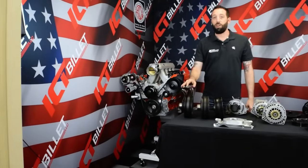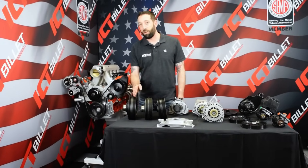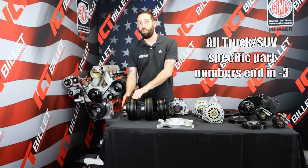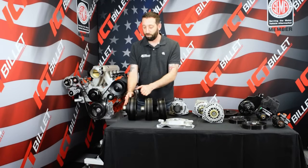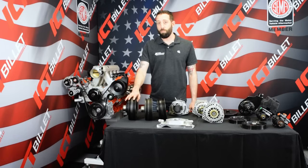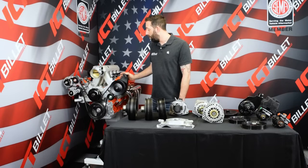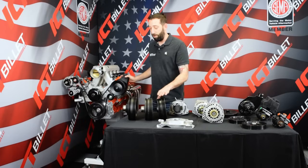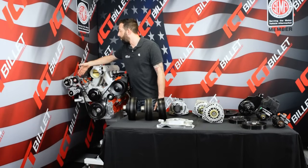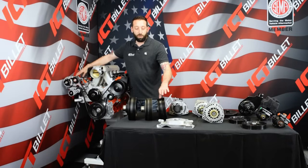The next thing you'll need to know is the belt offset. This one here is a truck and SUV crank pulley. You'll see the hub here is really long, so this brings the belt out the furthest — furthest away from the block. This will give you your most options as far as accessories like this truck power steering pump here. This cannot fit with this pulley or that one because it would go back so far that it'd hit the head. Same with this alternator here — it would have to be out past the head to be able to use that Camaro crank pulley or the Corvette.